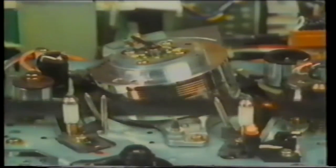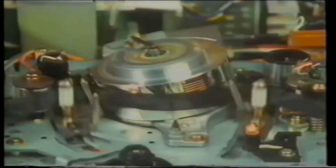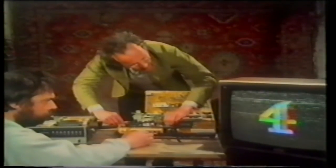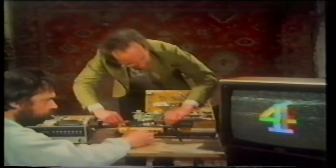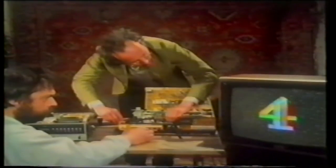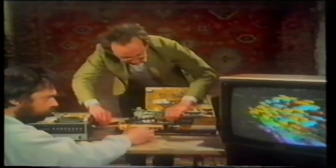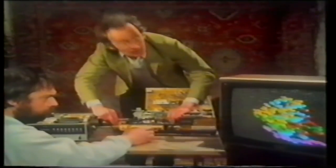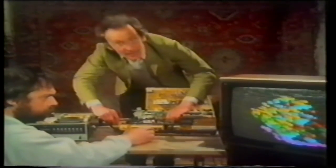Of course, in the real machine, the stripes are much closer together. With the machine still connected up and a bit of tape laced in, you can see that when the tape's stationary, the spinning heads are reading one stripe over and over again, and this produces the still picture. Moving the tape backwards and forwards changes the picture. It's not a very good picture because my fingers are creating quite a lot of interference. And of course, if you move it at 25 stripes a second, it replays the tape exactly as it was recorded.